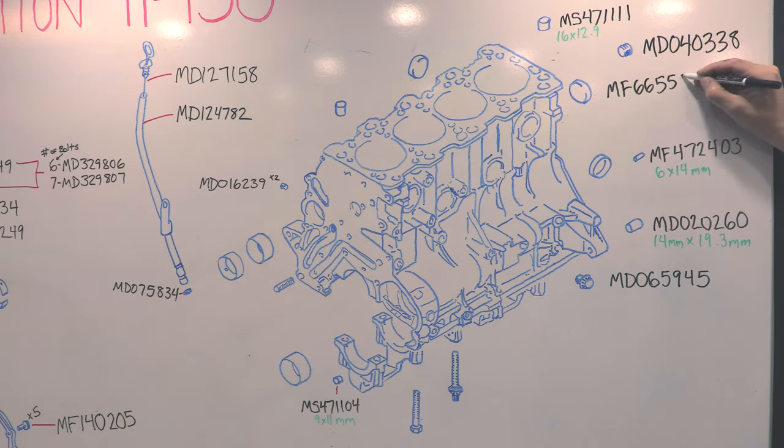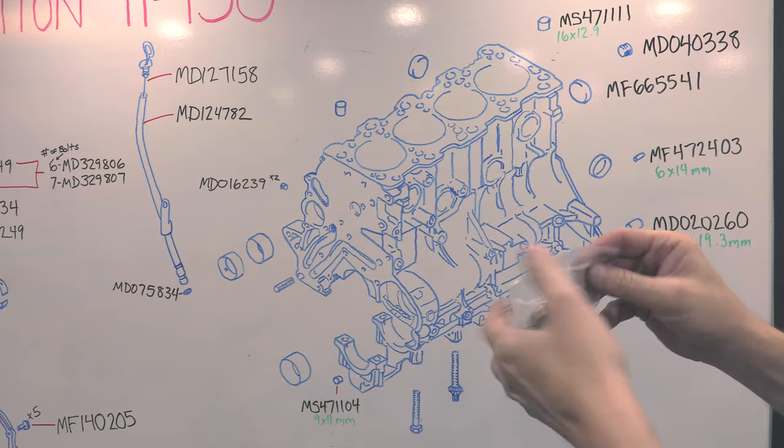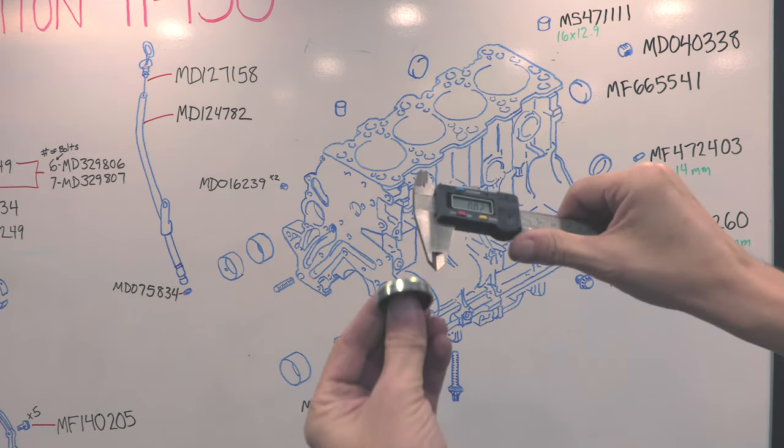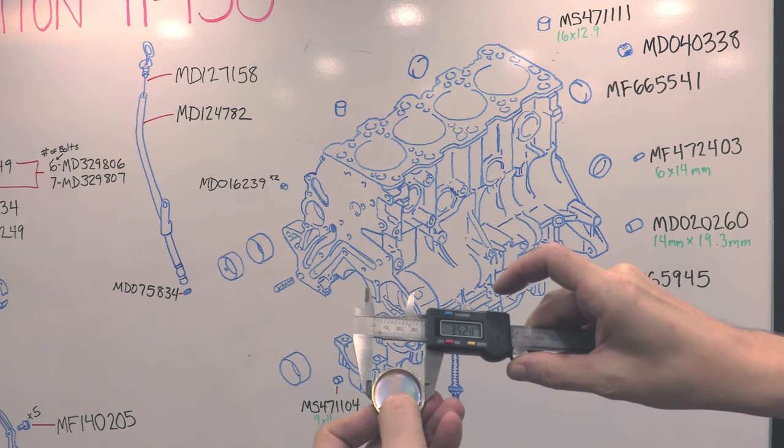I changed my shirt so that I can call these freeze plugs. On a 6-bolt, we've got it easy. One part number produces perfect results for all 9 freeze plug holes. They're all the same size. We don't have to chase down different sizes. Nope. That's everyone else's problems.